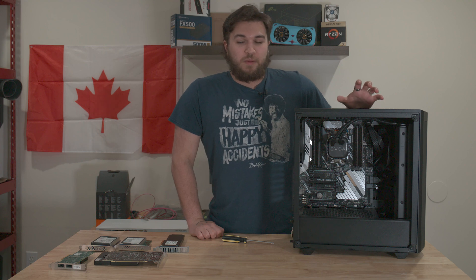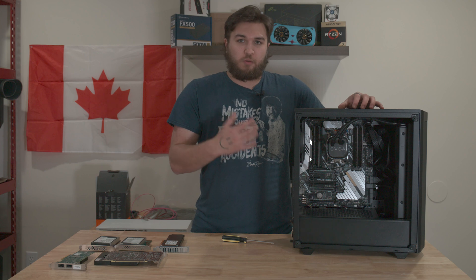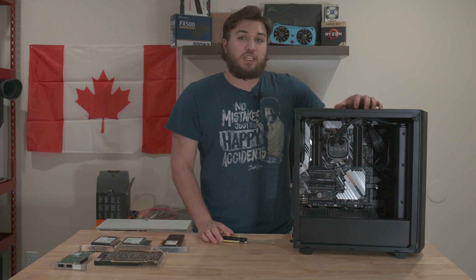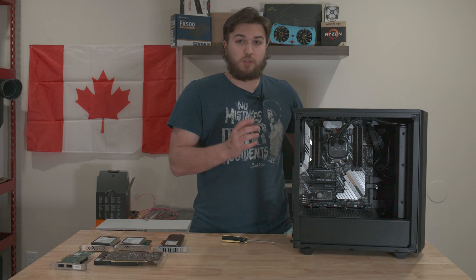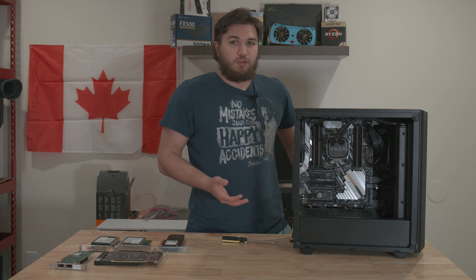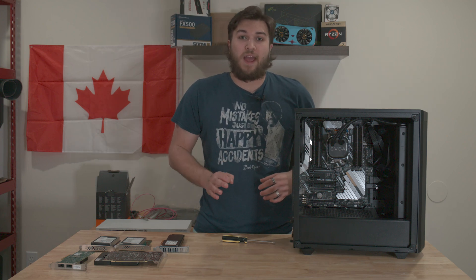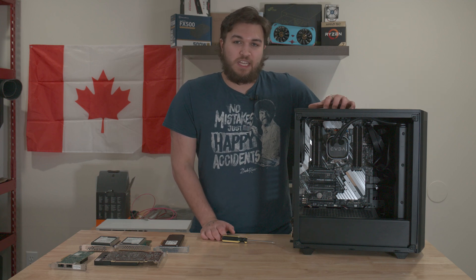You may recognize this build from a past video where I built a streaming PC in this case. I opted to change that out for a different, smaller streaming PC, but that video may be linked in the description below. What's in it is a Ryzen Threadripper 2920X — a bit old but completely perfect: 12-core, 24-thread, decent clock speed for NAS workloads. You don't need much CPU for that, and we chose it because it has a ton of PCI Express. All these slots on the motherboard operate at their full electrical capacity, which is awesome when using as much PCIe bandwidth as we will be today.